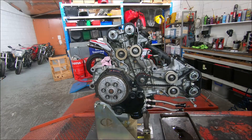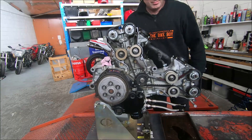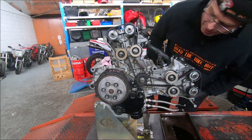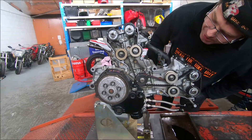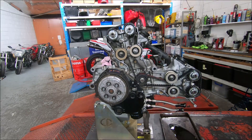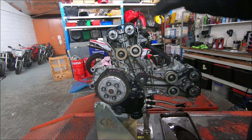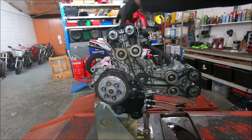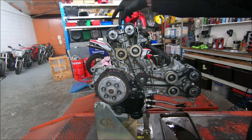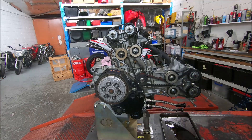I'm going to the other side of the engine. Okay, it's pumping oil out of the sump and out through the oil cooler hoses. If you are doing this with oil in the bike and you haven't got the rocker covers on — which I don't have here, I'll do the cam timing next — the rocker cover screw holes are open to the oil. If you have them open, eventually it'll pour oil out of them, and it just goes absolutely everywhere.